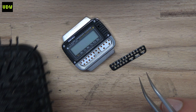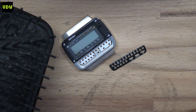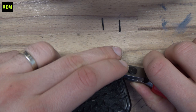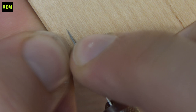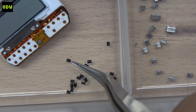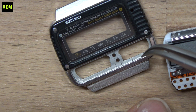I'm going to use fibers from a hairbrush — yes, it's a bit gross, but from a stiffness and shape perspective they're excellent replacements. I'll cut them to an appropriate length. These need to be 1.5 millimeters tall by 1 millimeter across — though 0.8 millimeters can also work. Mine are about 0.85 to 0.9 millimeters.